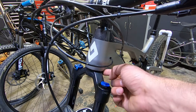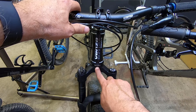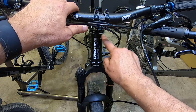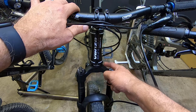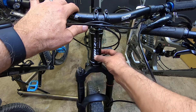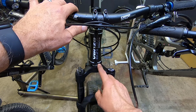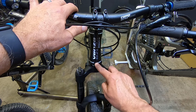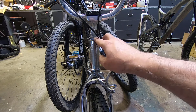Looking at the middle hybrid bike, you can see there's an external bearing cup on top and an internal cup with an internal bearing. Originally I had a straight steerer tube here, so the cup that was here before was inside and the bearing was inside the tube. The downside is that when you do this it works, but you add that distance to the stack height.